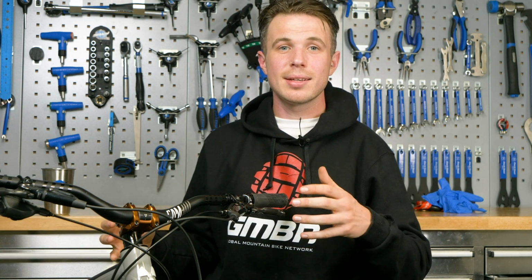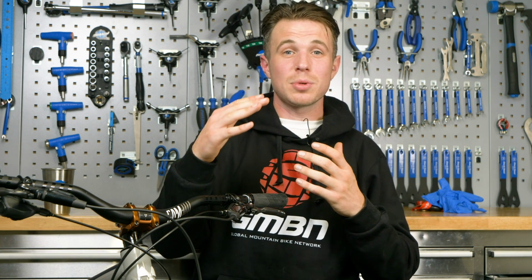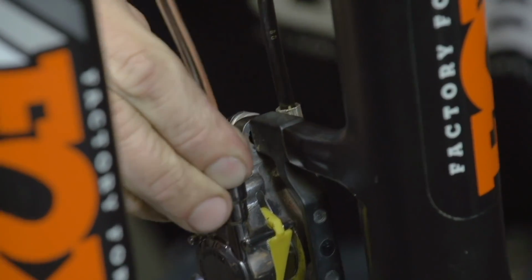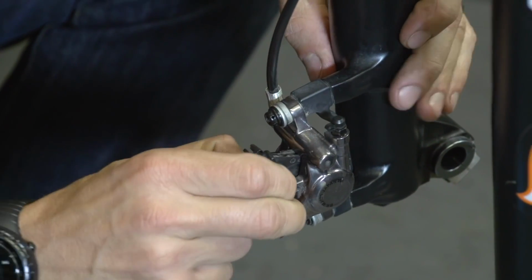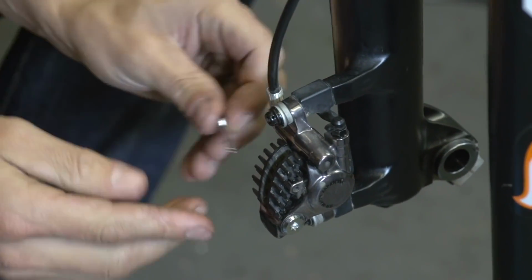Now let's look at the systems used within a Shimano brake, for instance. Shimano uses essentially one pressure system inside the brake, which is gravity bled. That means that oil works its way towards the bottom and air works its way towards the top. That's why a bucket system is so effective on a Shimano brake. TRP is another example which uses a similar system. Now this is robust, it's simple, but it does sometimes have issues when the pads wear faster than the system can adapt, which I'm going to get to in time as well.